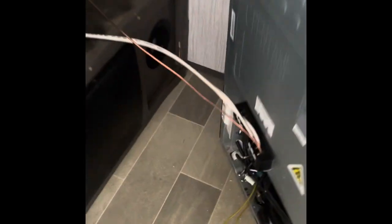So what I did was get a wire coat hanger, straighten it out, and come around to the back side. I ran it up into the bottom of the hole, and once I got up near the top where it was blocked off, I just kept ramming and poking until I started seeing the expandable foam fall out the drain hole at the bottom. Then coming around to the front, I could see it pushing the foam out the hole on the top shelf.